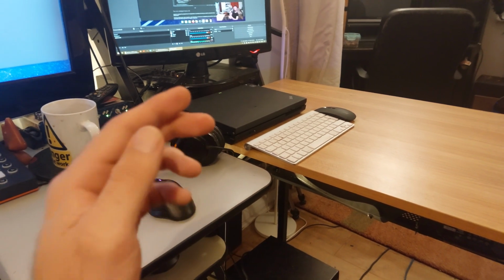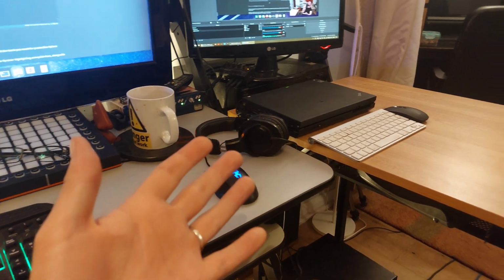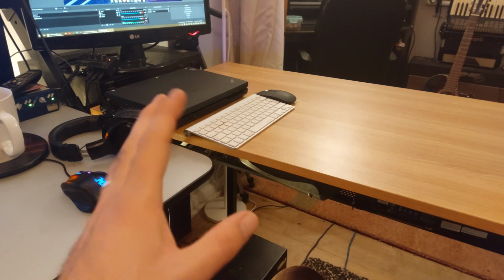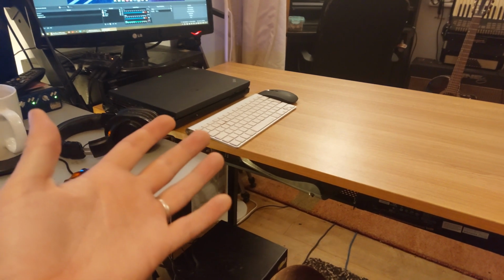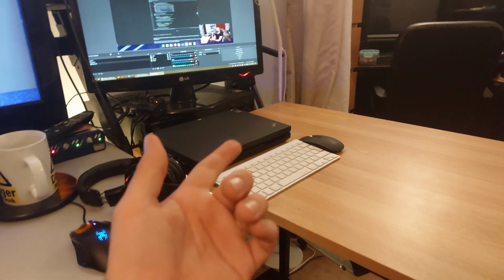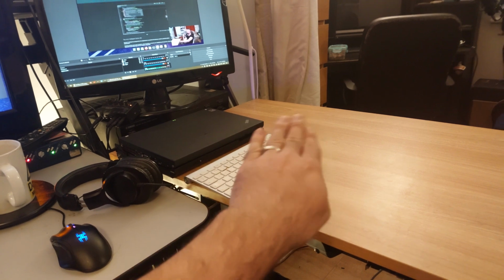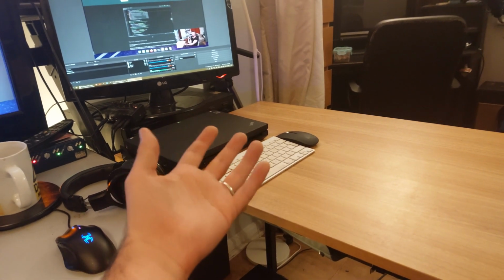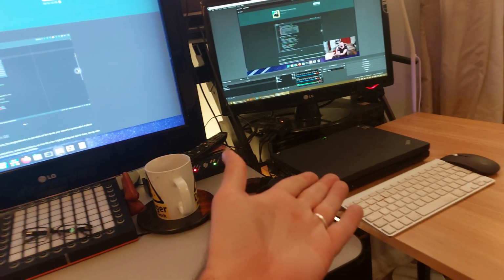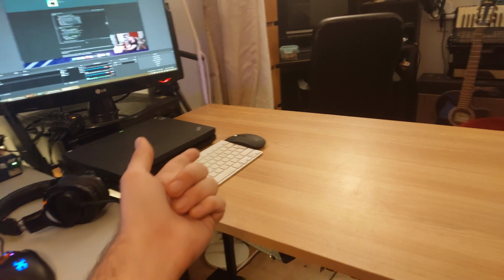So it runs as well, if you get a decent SD card, as a hard drive. I can't remember the exact speeds, but it's faster than a hard drive. It's certainly faster than the 5,400 RPM drive that was in there. But the other thing I forgot to mention, I managed to get the caddy, the hard drive bay, to just work somehow by putting a proper caddy on it and giving it a little bit of finagling. So we've now got the main drive bay working, plus PopOS in the ultrabase, plus Arch Linux on the SD card.